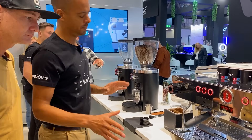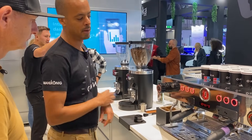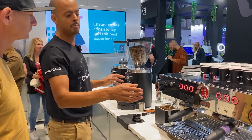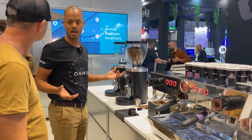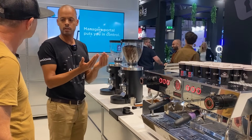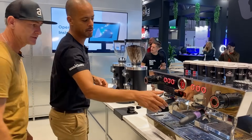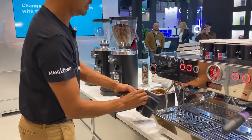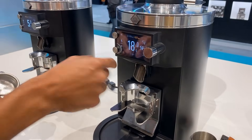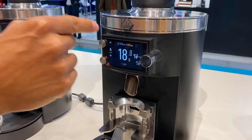Here's how it works: you go through the first grinding process, tamp using the puck press, put the portafilter in place, and brew. Let's say you get 30 seconds — the data goes to the cloud, over to the grinder's cloud, and back to the grinder in a matter of seconds. The grinder interprets the 30 seconds versus the brew time target, and says this isn't quite matching, so it makes a grind distance adjustment. On the recipe display you can see the link icon and the cloud icon, meaning it's a linked recipe and everything is connected. Here we go — a first shot, a simple weight-based double dose of 18.1 grams.